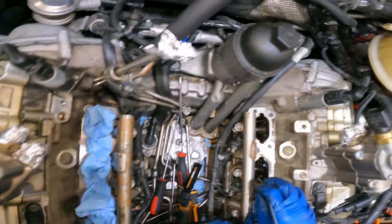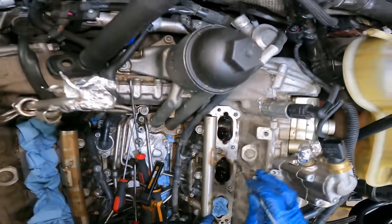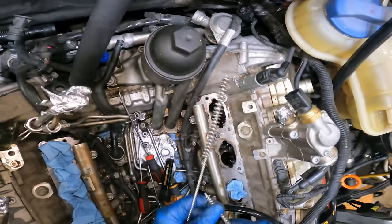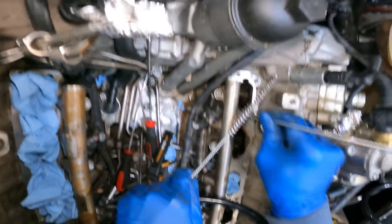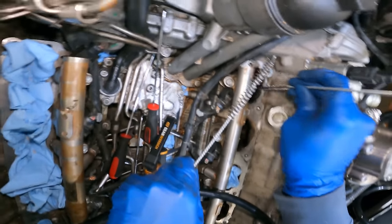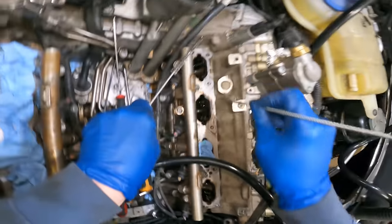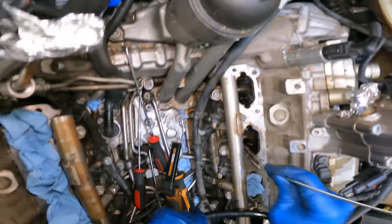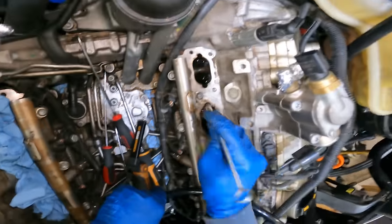We're back in here. I hit the little slots right here too. Okay, we'll hit it with this one first because he's jamming. And remember guys, you don't gotta do none of it like this. This was really caked on there with a lot of carbon, so I'm just scrubbing it all down. Like I said earlier in the video, if your car is not that bad with that much carbon buildup, you can get away with just blasting it with walnuts and being on your way.